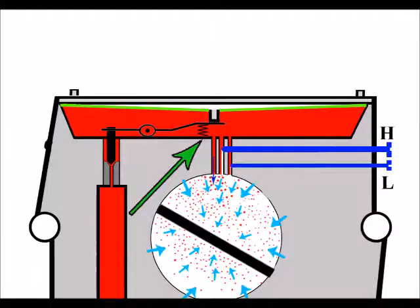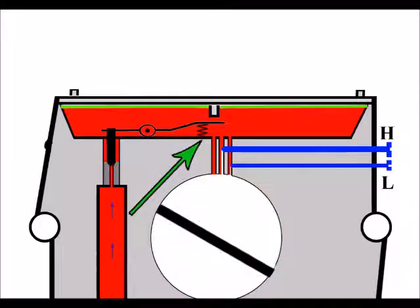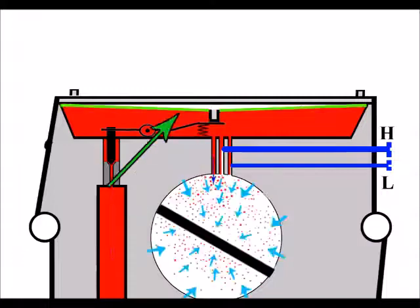Take a look at this scenario: the diaphragm has come down to the back of the lever, and because that spring is too hard it won't push the back of the lever down any further. So we're not getting a full range of movement from the diaphragm — it's moving up and down but we're only getting a small amount of movement on the needle valve, which is not sufficient. The diaphragm itself is in good order, the spacing is correct, but because the spring isn't correct we're not getting enough movement on the needle valve to allow sufficient fuel to come through and run the engine.